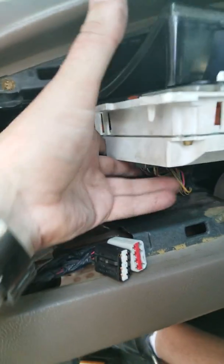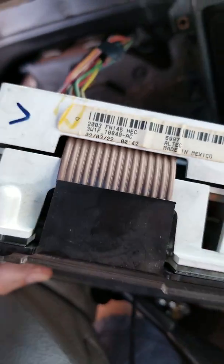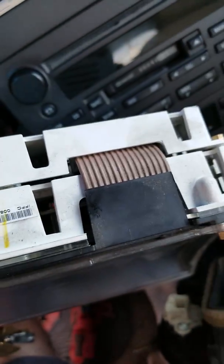What I like to do is take the back casing off. You see these wires right here — I take off the back casing and just make sure the connections are good on those as well. I don't unplug them, I just make sure the connection is good. Back here where it's plugged in, get yourself some dielectric grease — some electric grease — and put a little layer on there before you plug them back in. That will give you that good connection and continuity you need to light this cluster back up.